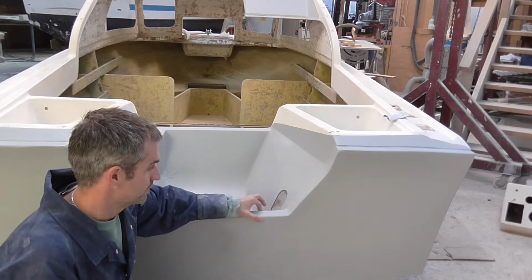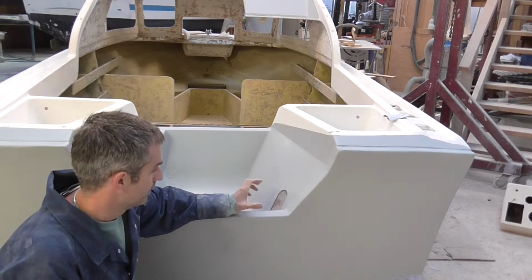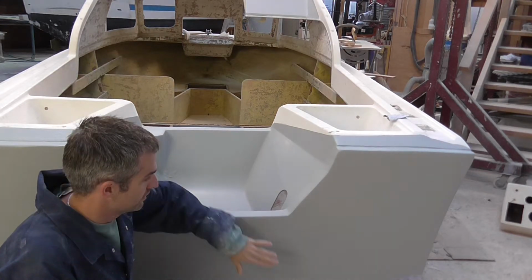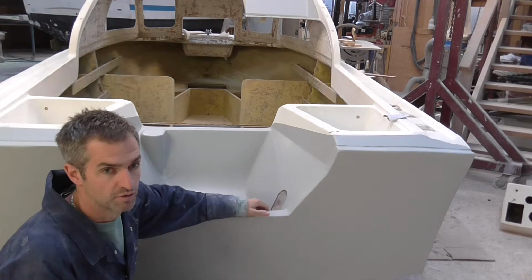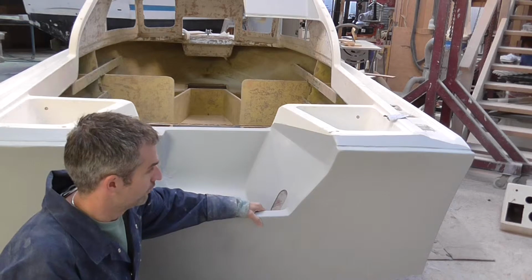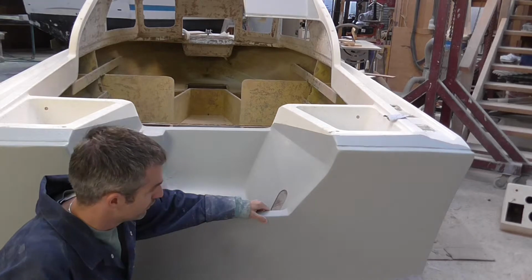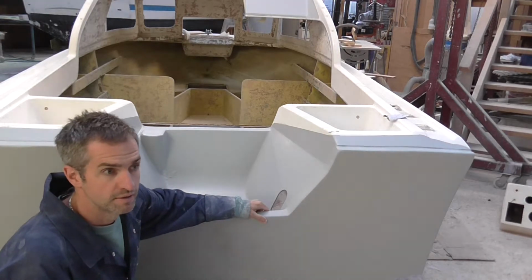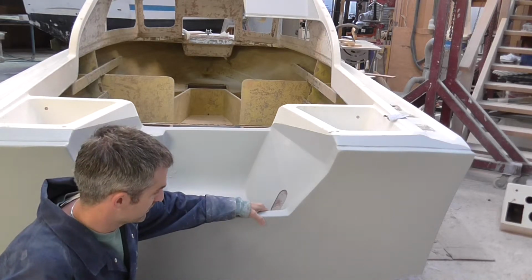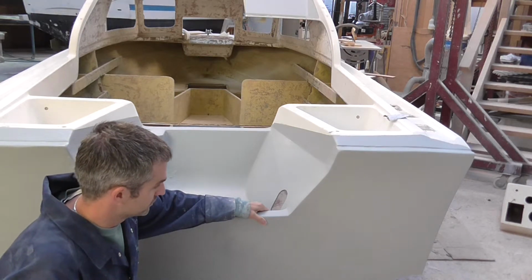What we've done is squeeze two sheets of ply together using 600 mat, and also putting a layer of 2600 on the back, and then what we do is we squeeze this front surface down onto a gel coated sheet of melamine, and that gives us a smooth surface. We then cut to size and insert from the back, and what happens then is when it's inserted, it gets put down on a layer of resin and talc bog. So that gets sat in there, finds its location and sits for a couple of days just to cure.